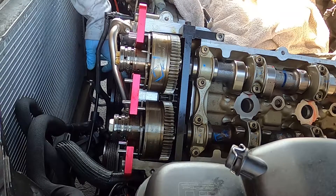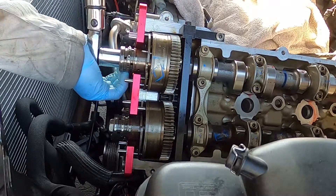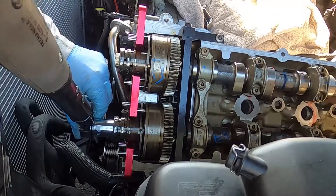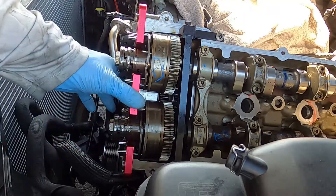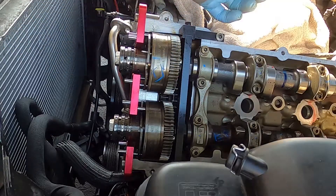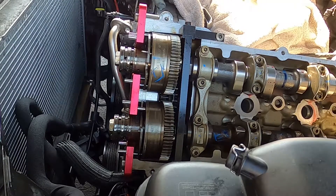Double checking, making sure the crank is still at 40 degrees - both my marks are still lined up here, so I'm going to go ahead and get this torqued down. We've got that torqued down. Now we can take the T30s off from here and here, and we may need to wiggle the actual cam around a little bit to get that back locking off.